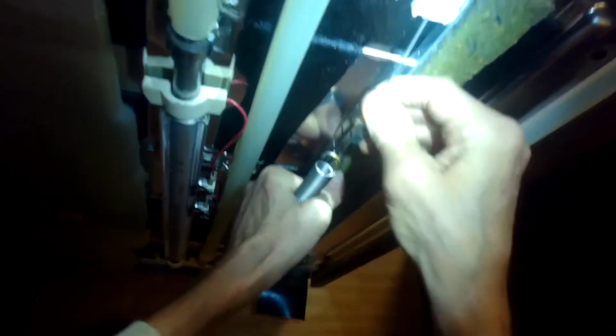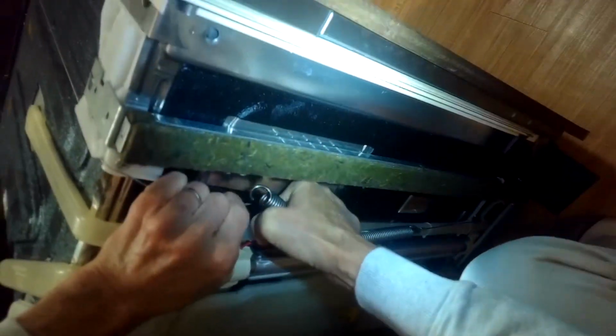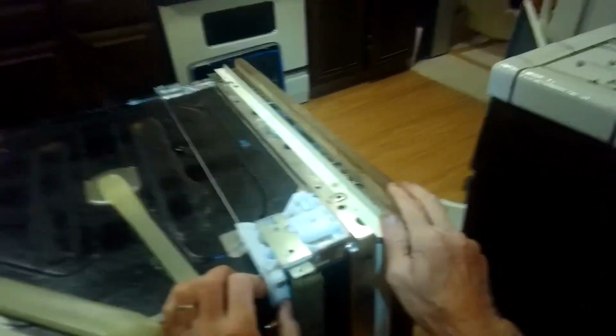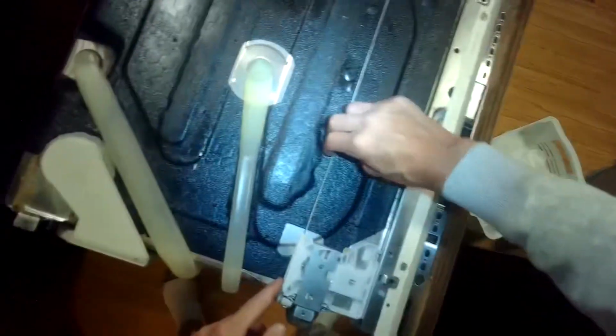Take off the old one. Here's the new piece. So I'm going to use that same technique to help have my knee kind of help me. Leverage point. So I'm going to put my forearm against my knee, grab the spring, and lift. Connect those two. It's pretty good. So that's going over that plastic cam now. Goes down. We have good spring tension, and then to get the final tensioning, there is a screw there that we can turn once we reinstall it. Get a nice good tension there.